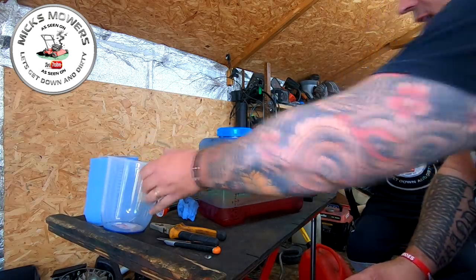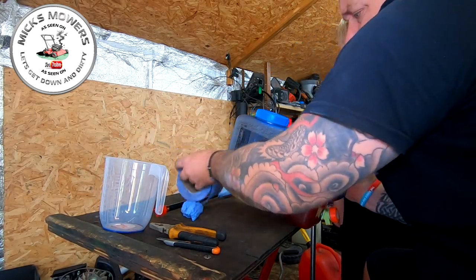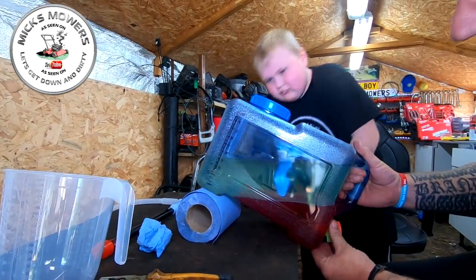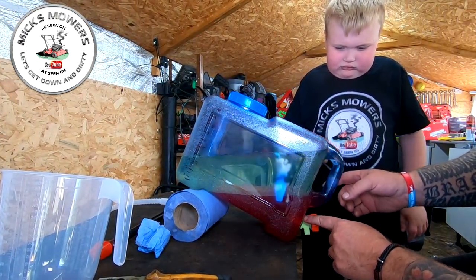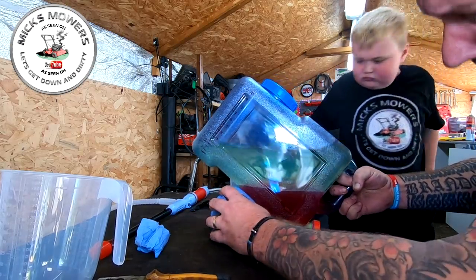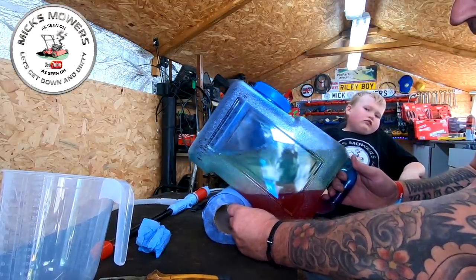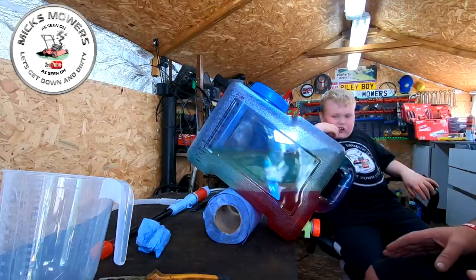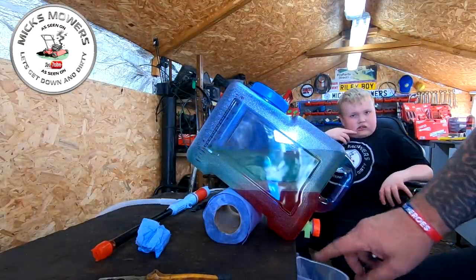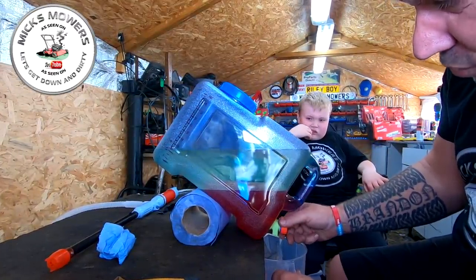For this exercise I'm going to tip the container up slightly on a screw to raise the level of the tap, so I can get more out. We've got good ventilation — both barn doors are open, no naked flames. I'm now going to very gently open my valve and remove the water and ethanol content from this container. It looks like apple juice but I can assure you it isn't.